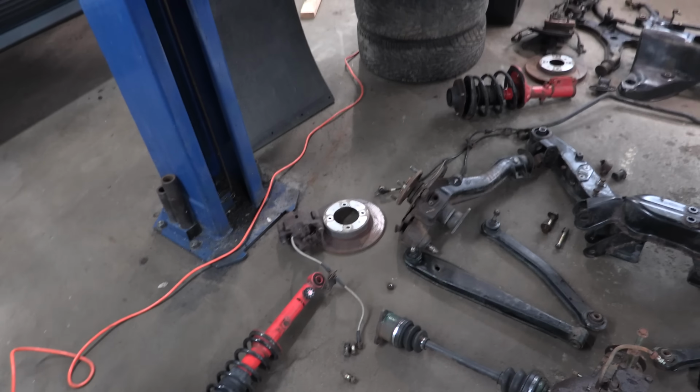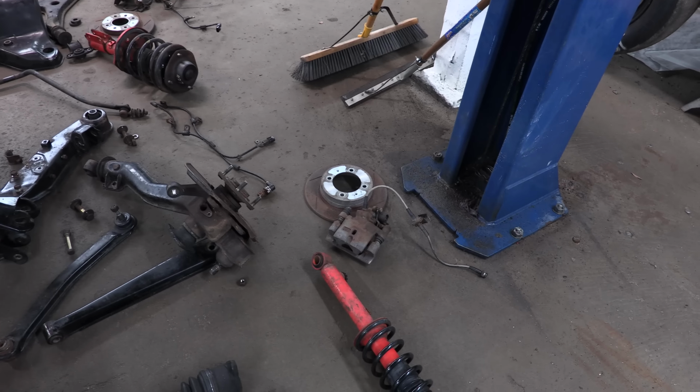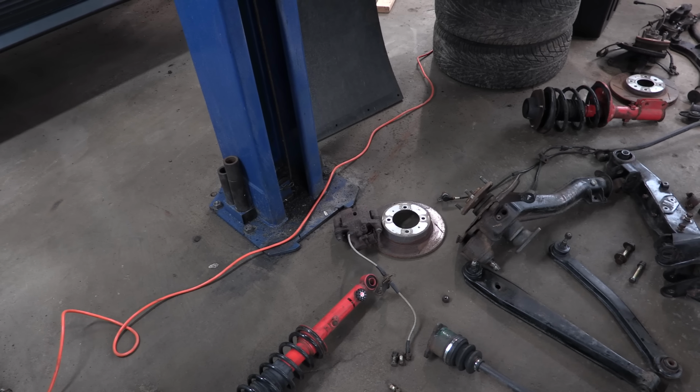As far as the brakes are concerned, I'm going to run those through the bead blaster, see how they clean up. And I've got two good ones, and I even have the original one that came on the car that I could rebuild. But I'm thinking about maybe powder coating those. Don't know if I want to keep them or not. We'll see how this turns out. I probably will because, hey, Galant VR-4. It's already got great equipment. The front brakes that came on it are good units that people actually seek out as upgrades. They're dual piston calipers, and a little crusty and rusty, but they'll clean up nice. And nice big brake pad on it. So I don't know if I really want to change that. I might just clean those up and make them pretty because it's actually fairly decent equipment.